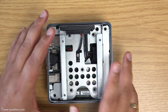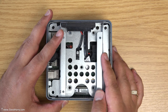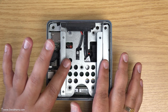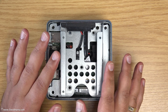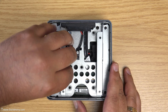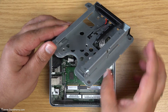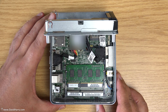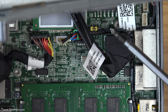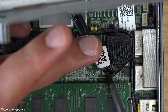Now what we're presented with is the drive mechanism for this particular NUC. This is where our SATA drive goes in — in this instance I'm using an SSD. This will take any 2.5 inch drive of the SATA variety. I'm going to lift this out to one side and look further inside, because I'll do the RAM first and then the drive. I'll move it to one side because if you don't do that, you'd have to take off two cables — the SATA cable and the power cable which is just next to it underneath.